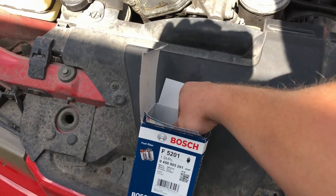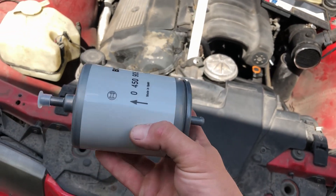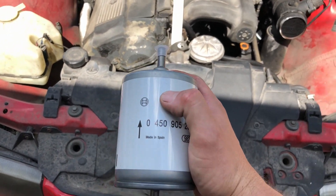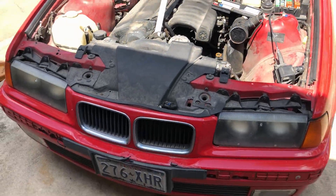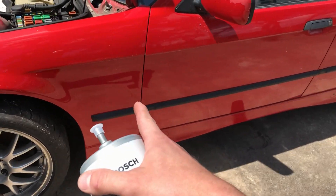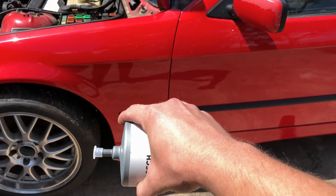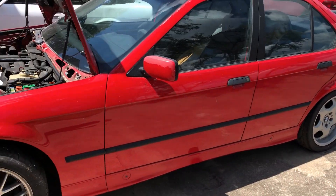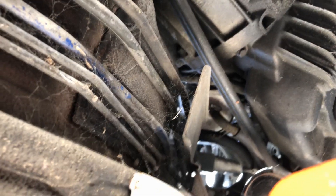So I have a new fuel filter and that's what we're going to install next. I got a new Bosch inline filter, just a little canister one — arrow is the direction of flow, tank side to engine side. I'm pretty sure on these OBD1 — this is a '93 325i — the filter is about here on the driver's side frame rail underneath. So I'm going to jack it up, verify that, put the car on jack stands for safety, and take a look.